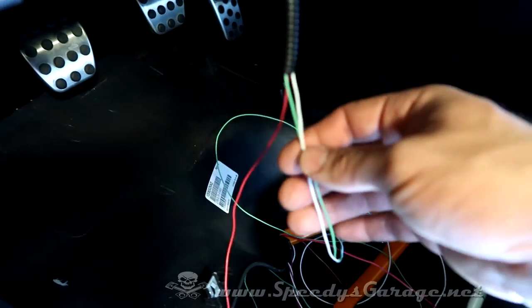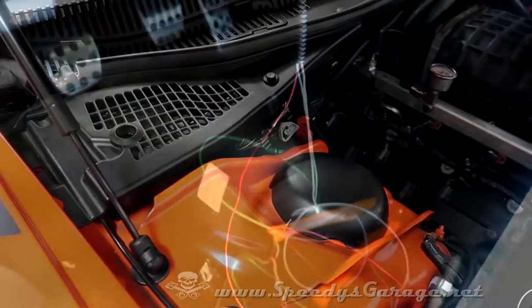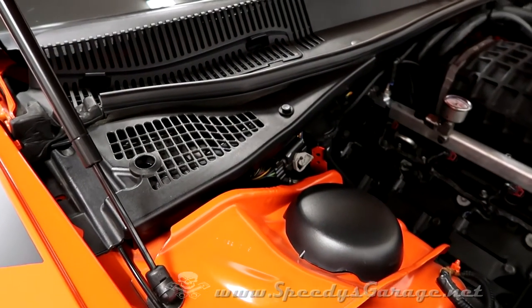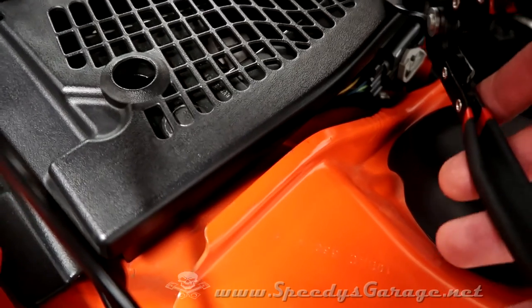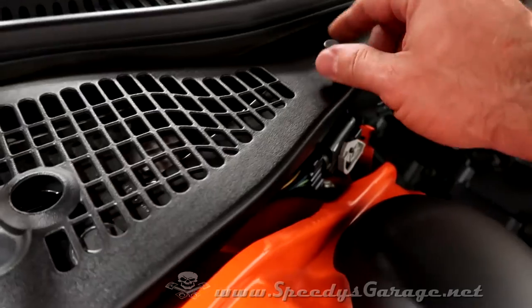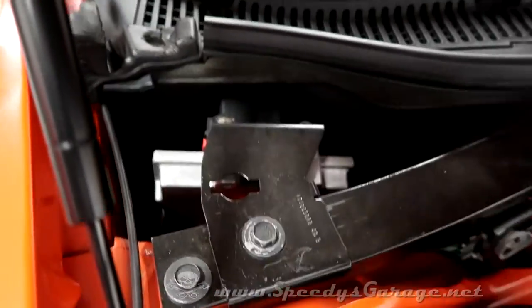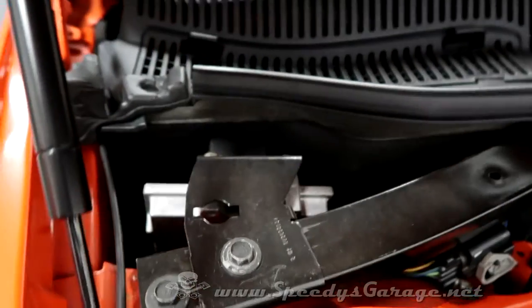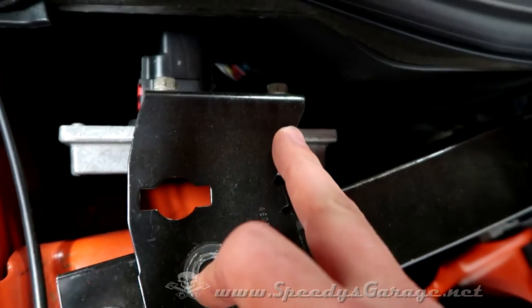The power will get hooked up there. The white and the green wires will then get routed out to the engine bay. We're close to running the RPM signal and clutch switch wires. Let me take a look at the computer, which is just underneath a couple of little plastic pop tabs — one there and one on the other side, which I've already removed. Here's our computer, held onto a bracket by a 14-millimeter bolt.